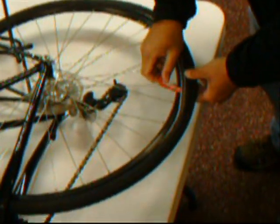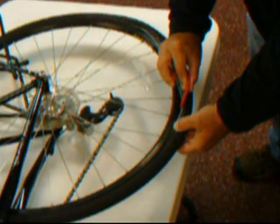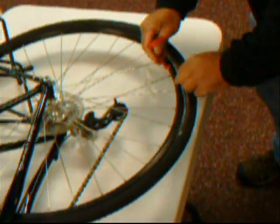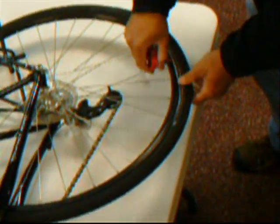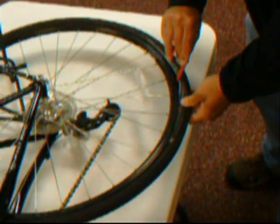Once I have rolled over the top, I am hooked on top of the rim and now I can use it to lever the tire bead back on again — hook, insert it and turn it over, pry it on over.